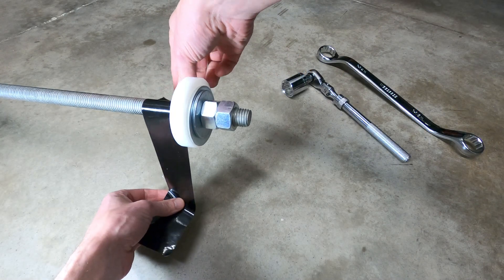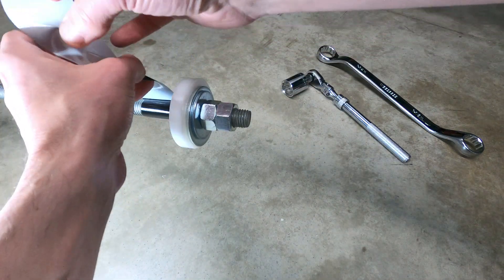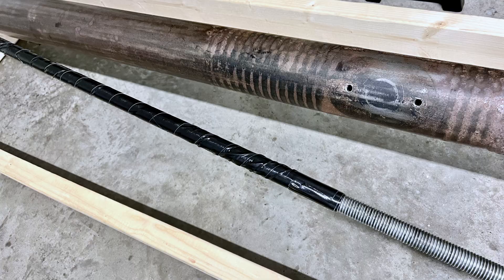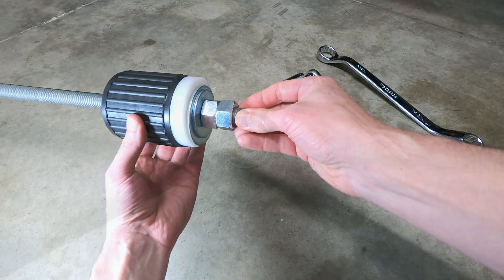As the super bearings are being placed at different depths, you should apply duct tape over the threaded rod portions that could come in contact with the inner rubber bushings so they'll be protected from damage. This includes the short portion at the end of the rod that will always be inside the super bearing as it's being installed.